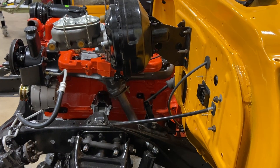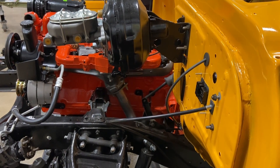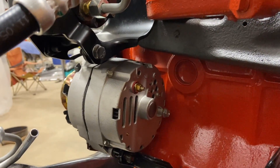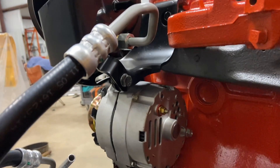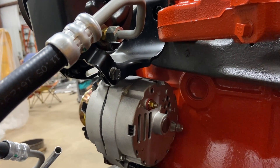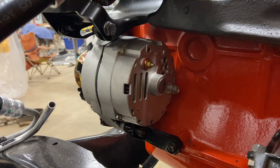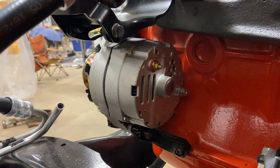Welcome back, everybody. We're going to start off episode two of King 71 with a problem we found. If you look at the alternator down here — get the camera in here — you see the plug comes out the top. If the power steering bracket wasn't there, if that wasn't an option on this model, would have been great. But it seems to be coming out in the wrong position. On this episode, we're going to show you how to re-clock an alternator so you can change where the wire comes out of it in relation to the front mounting bracket.